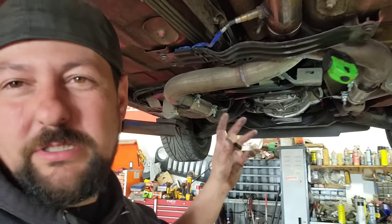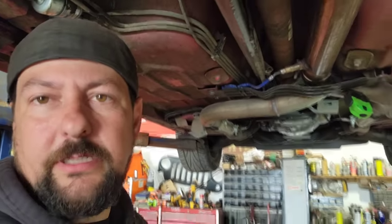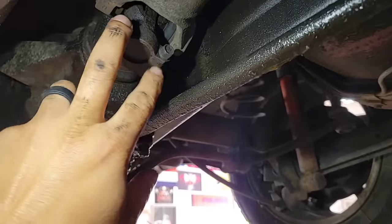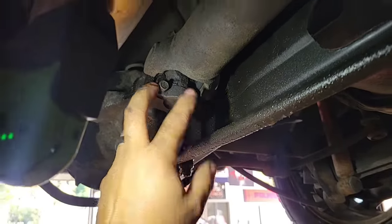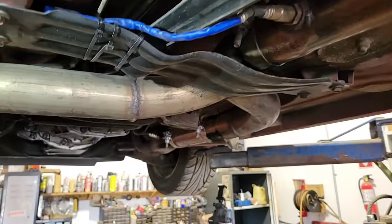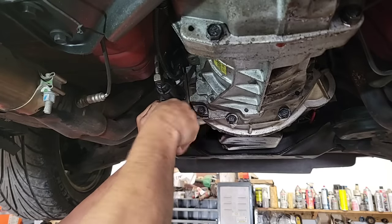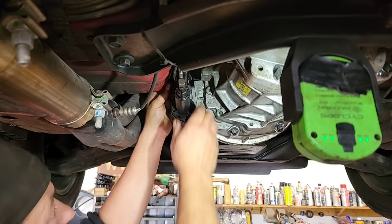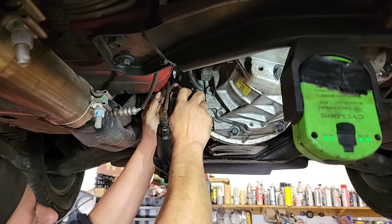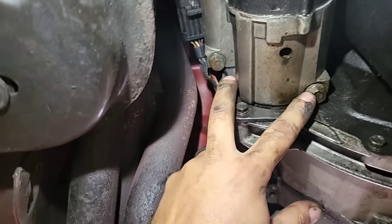Let's drop that transmission out of there. We've got to unbolt all the bell housing bolts, pull the drive shaft out, and the torque arm has to come out. We'll just unbolt the slave cylinder and let it dangle — that way we shouldn't have to bleed the clutch when it's all said and done. So we're going to grab 7/16ths, undo those saddles off the back yoke there for the U-joint, get that out, and slip the drive shaft out. I do have a buddy here helping me — he's a little camera shy — so I'll let him do some wrenching while I explain.